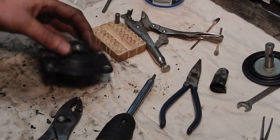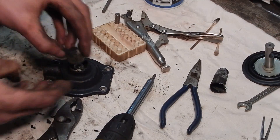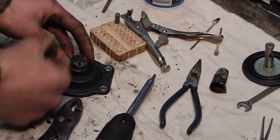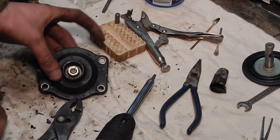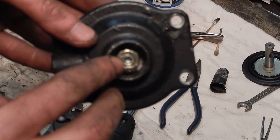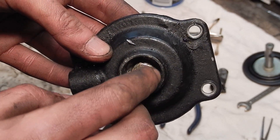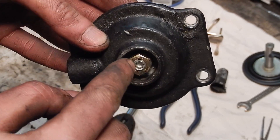I'm tinkering with the AFC top here. I pulled out the tamper-resistant cover — I just poked a hole in it with an awl and pried it out. Now in here you can see there's a Torx screw and a lock nut. That lock nut is 13 millimeter — I've already loosened that.